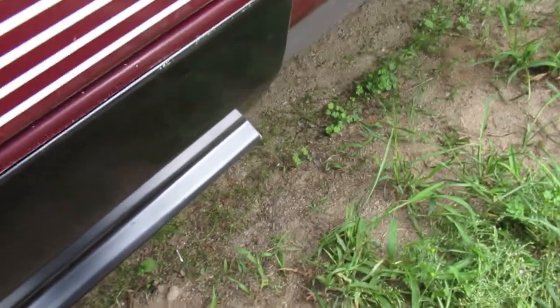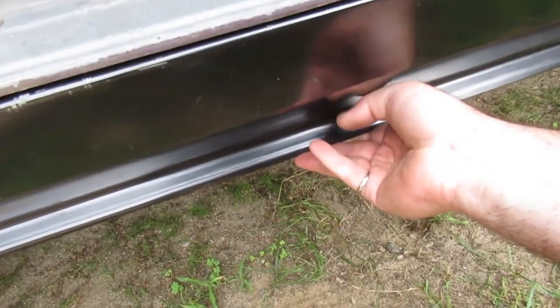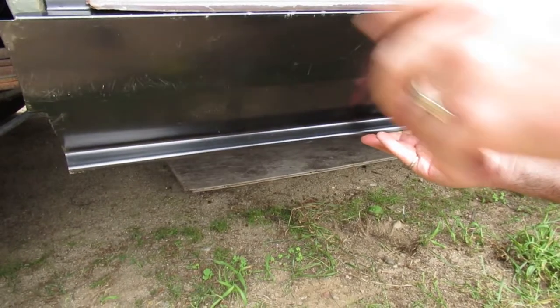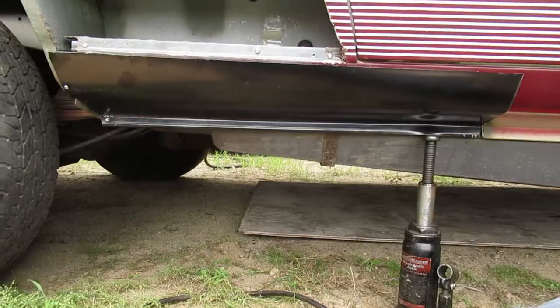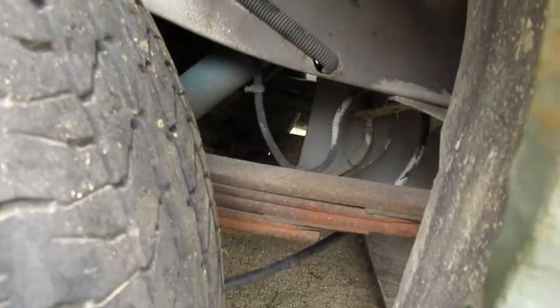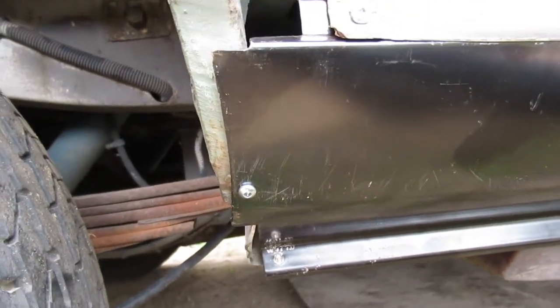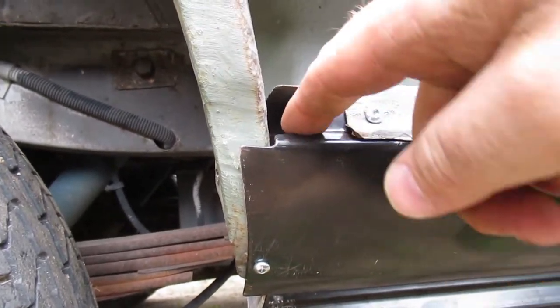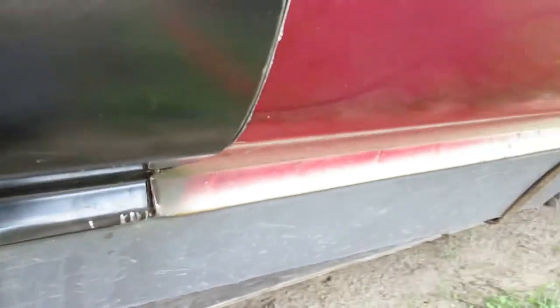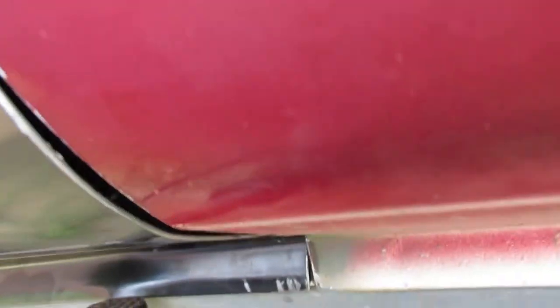It's in there pretty good. I need to figure out that body line — it's not quite bent enough in the middle either, so I need to give it a good kink. I'll use a couple of teck screws to hold it while I work. I had to rejig the mounting — there was about a three-quarter-inch difference. The gap at this end is more than I'd like, and the profile changes a little, so I need to figure out how to make that look nice and tidy.